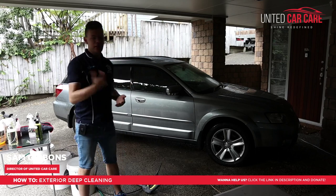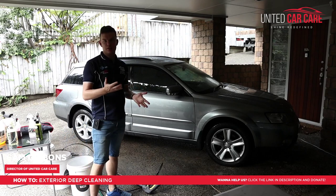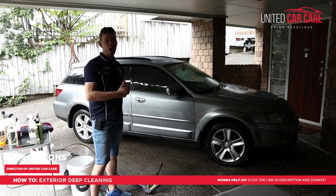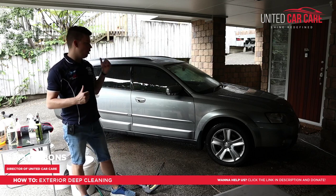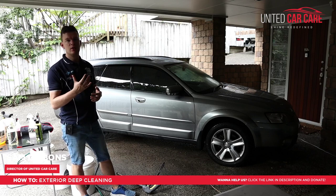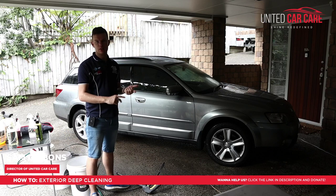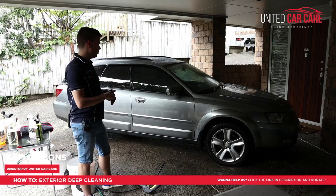So let's take that Tesla from last week, for example. Let's assume that Tesla had been driving for another 3 months and we wanted to not polish it again. You could wash that and just Iron Burn or Dragon's Breath the paint and then leave it at that, okay? You don't need to do anything additional. It's safe on top of coatings. It's safe on top of waxes, okay? So iron removing is a safe top process.